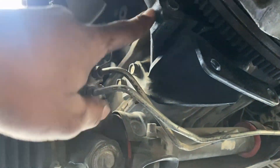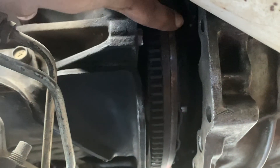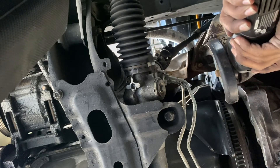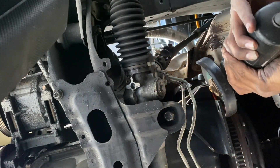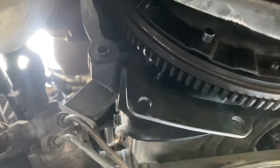I'm under the car right now and I just found out there's a dowel pin here for the transmission that lines up on this side. What happened is I was tightening the transmission — this transmission also had a dowel pin sticking out, but I tightened it so tight that it pushed it in. I don't know if this is from the last transmission I put on, because it's stuck in here. I tried to take it out but none of them would come out. The one on the transmission side is now flat. I'm going to go ahead and try to grind this down, and hopefully that'll have the transmission mate up flush to the block. I got it pretty flat — it's still slightly raised here but that should be enough for the transmission to sit flush.